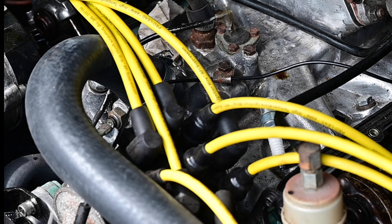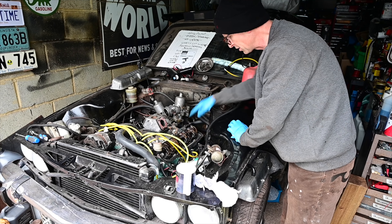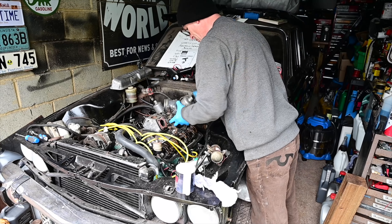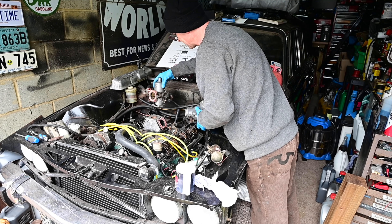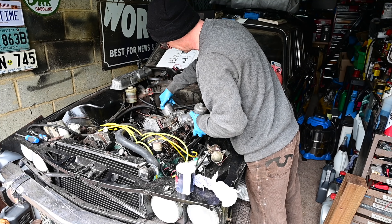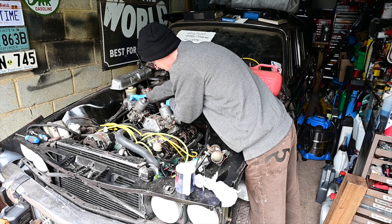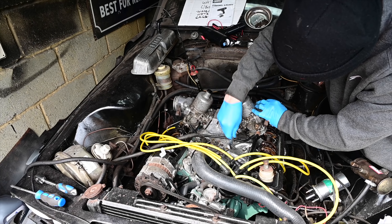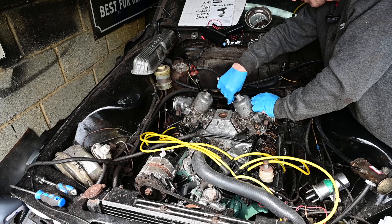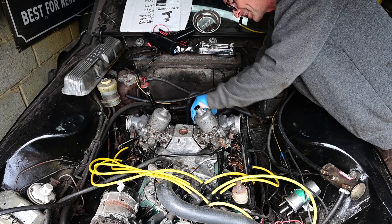Yes! We've got about 70 PSI - that is a good thing. Fantastic, we've got compression on this engine, which means chances are it'll start! I'm going to put the carburettors back on, reconnect all the spark plugs and leads, and see where we go from there. Fingers firmly crossed. I'm trying to remember how all of this goes back together again - it's a jigsaw. That's all bolted on. Honestly, SU make it so difficult to do that, it's just unnecessarily tricky.